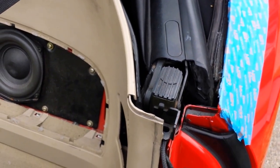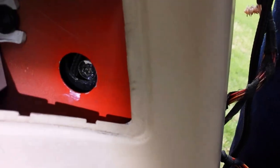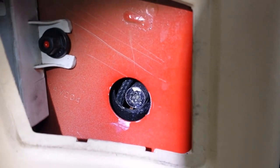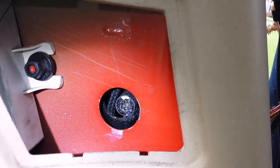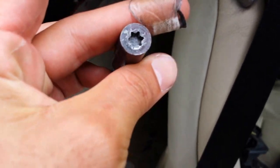Going back into your car, you have two T40 bolts — one is located in the air vent location. You have to take these out all the way on both sides. These are how they look: you have two of them. If you want to keep the top bolt on top and bottom bolt on bottom so you don't mix them up, mark them now.